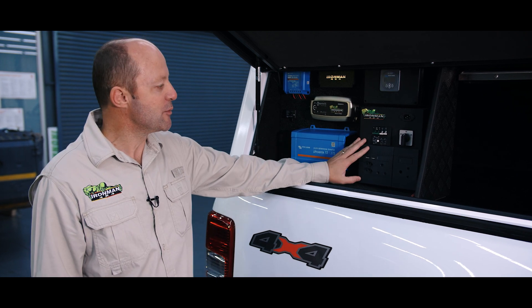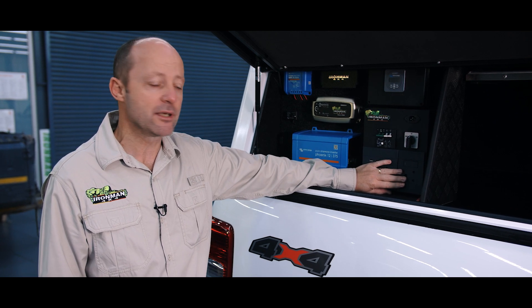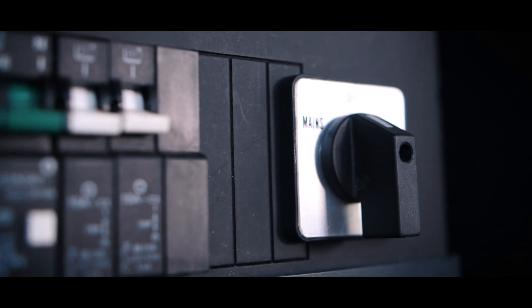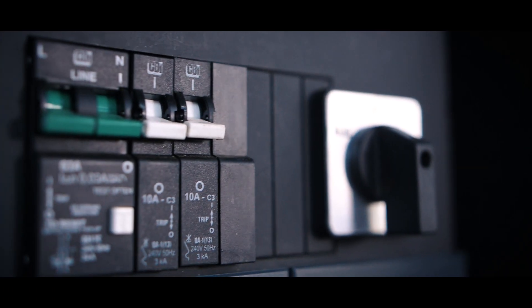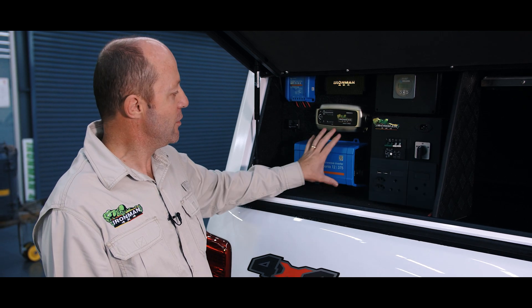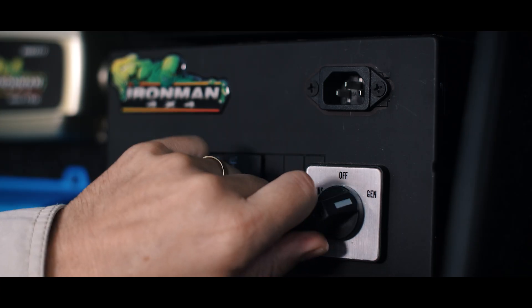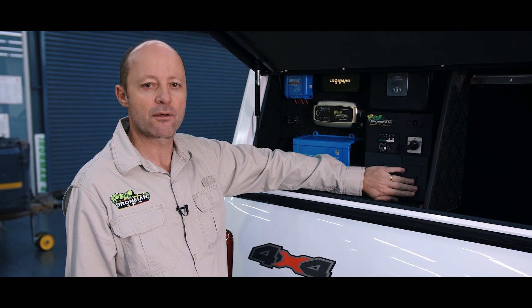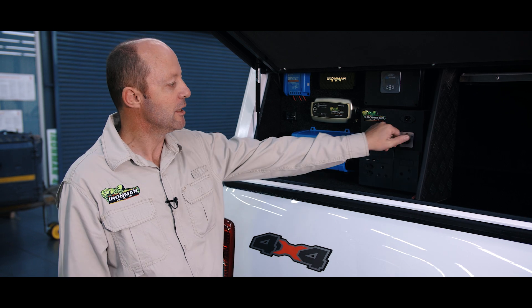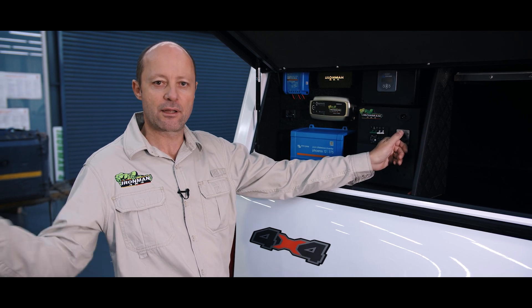What we have over here is our switch box. It features the 220 volt plug points, which are connected to the inverter and to the shore power depending on which one you're using. These circuit breakers are a safety feature — if you're using camp power and the power is unstable and there are power spikes, this will prevent any damage to the electrical system. The switchover switch is very simple: if you're using the inverter, switch it that way and these plug points are powered with 220 volt clean pure sine wave power. Switch it the other way when you're using the campsite power.